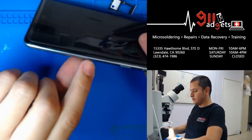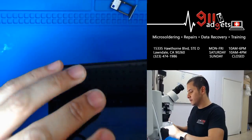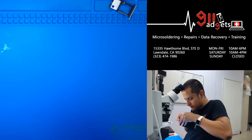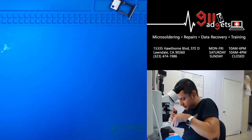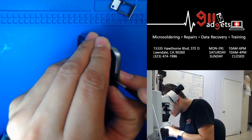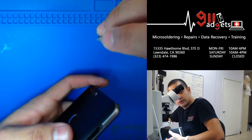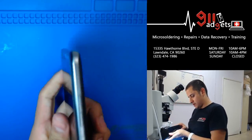Now, sometimes you'll see like the screen doesn't fit properly. Like, well, it's lifted. It's just the frame. You just gotta click it in. It's happened to me before. Just be careful, you don't want to put too much pressure. Sometimes you may have left something in there. You see, like right here, this has to click in. And it's not clicking in because the little bracket got bent. You see this bracket right here? There you go. SIM tray, it goes like this. You find the little hole. You see there's a hole there for the SIM eject tool and the hole here, so just line it up. And let's test it one more time.